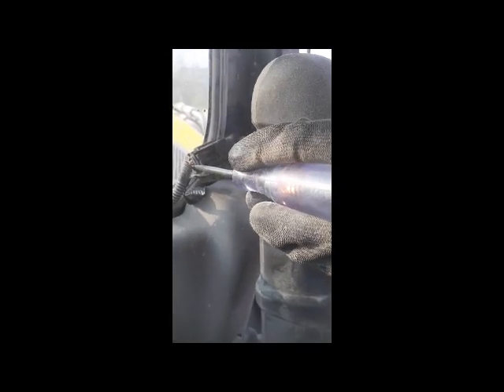The yellow wire has no power. So my sensor only works as a switch. This red one is the input power to the sensor, and this yellow one is the output — so power is not coming. When I put the safety downside in driving mode and the safety is locked, then you can see my power is coming on the yellow wire — the yellow wire has the power.